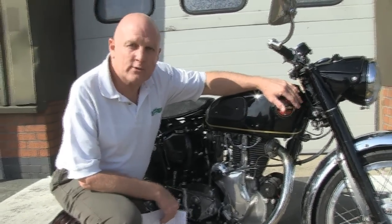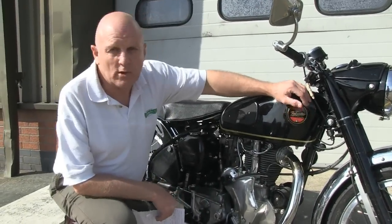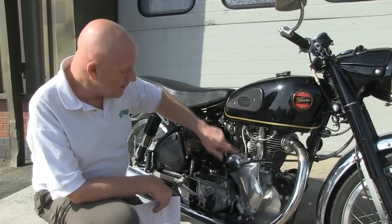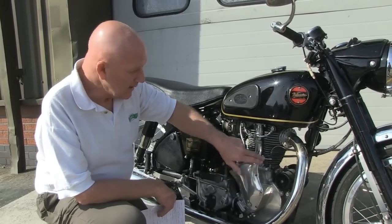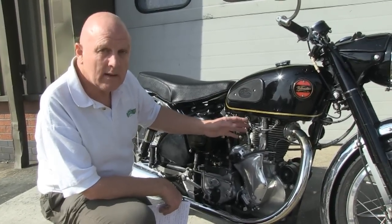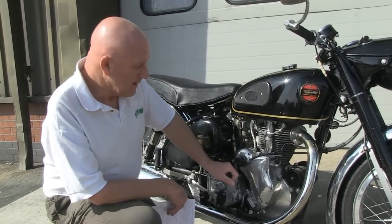He got it in 2004. He was tipped off by a regular Velocette specialist around here, John Hannis, owners' club, big noise. Tipped off that it was available. It was dismantled. There'd been an engine stud somewhere actually stripped in the cases, that's all it was. But nevertheless, Paul bought it and he stripped it down and repaired it and went through it, and it's plus 20 thou overbore, but it's still on its original big end after nearly 30,000 miles,